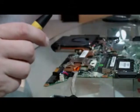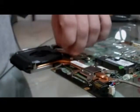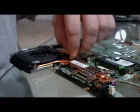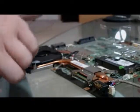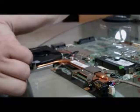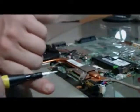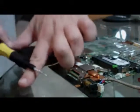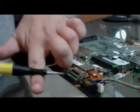Seriously. So what I usually do, because these little connectors, if you try and peel them out with your fingernails, you either don't have steady hands or it's just too tiny to get your fingers in there. You can usually take a screwdriver, and I like to use just kind of a prying principle, but very gently, ever so gently. Let's see, oh, I'm sorry, I'm out of the range of the camera. But I just use my finger as a fulcrum point, and I just go on either side and gently. If the plastic starts to tear, I move to a different spot a little bit to pry.